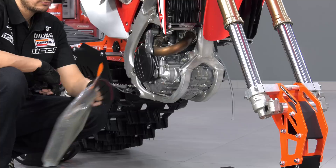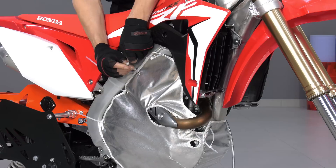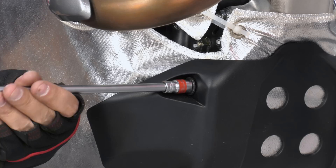A special sponge prevents accumulation of dirt for enduro use and ice on a snow bike. The engine should be covered with thermal insulation to prevent sudden cooling when falling in snow — otherwise, the fuel does not burn fully and flows into the oil, worsening its properties.